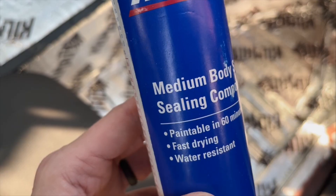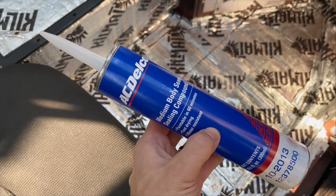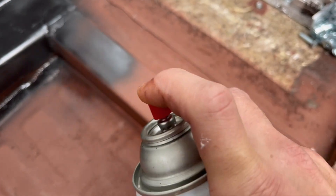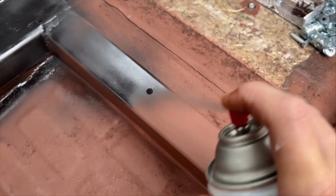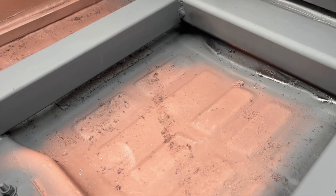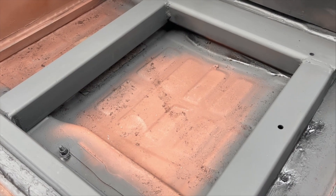I finished it all off nicely. I took some seam sealer and ran it around all the edges. I like doing this so if you ever get water on the floor or spill something between the seats, it doesn't get underneath and start rusting between the layers of floor and seat bracket — and it covers up some of those terrible welds. Then I took some black barbecue paint, because clearly that's rock bottom around here, and painted all the seat section black. If this might not get carpeted, I don't want to look down and see fire engine rust-red primer.